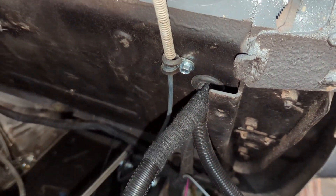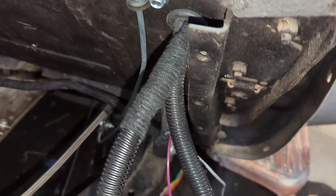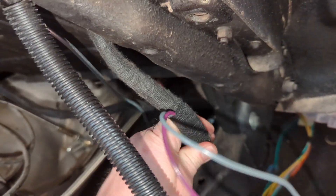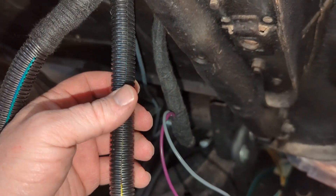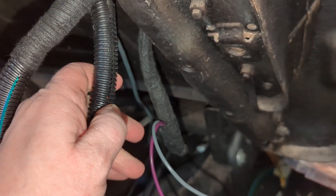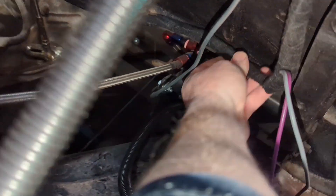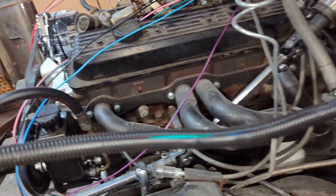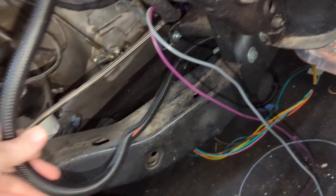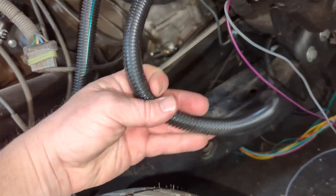So I've wrapped it. I have some felt tape that I got off Amazon, and I felt taped all of my wire — it looks like this right here. I'll probably slide some uniduct over this to protect it on this edge. I'm going to pin this down kind of back in behind and then go across up through here. This is my front lights. This one goes down to the back — that's got my fuel lines, my fuel sending unit, all my brake lights, blinkers, and stuff.